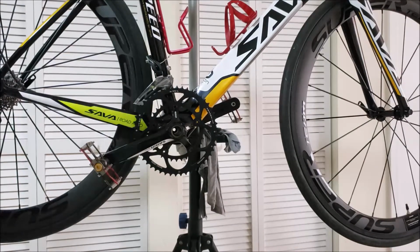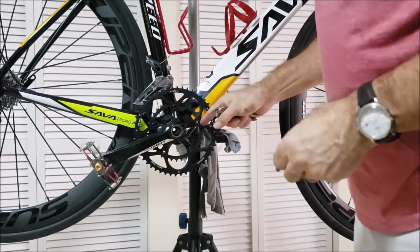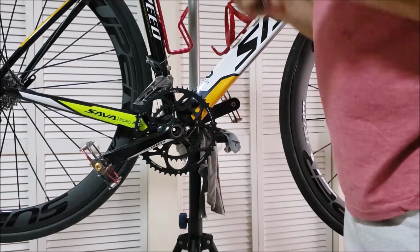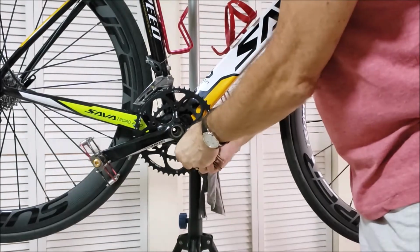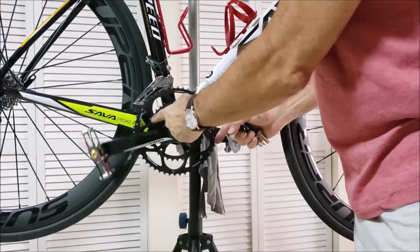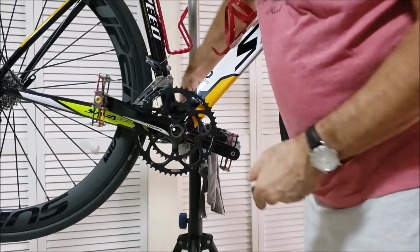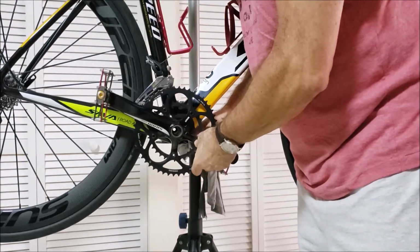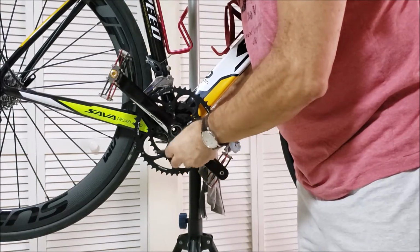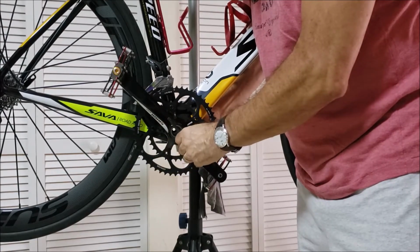Okay, I propped up the phone just to show you what I'm going to do now. I got my hex and my counter. I went ahead and placed these studs with the bolts in the rear. I forgot to mention, if any one of you guys tries to do this at home, don't mix these up. Keep them together and just snug them as you go in a circle. And then like I said, you come in from the rear and you hold the inner hex and you slightly tighten up on it, just as I'm doing, and it's snug right there, and that's it.